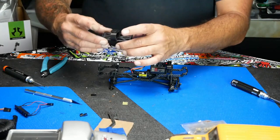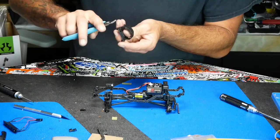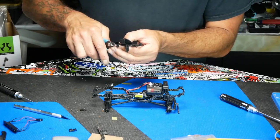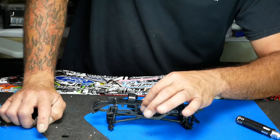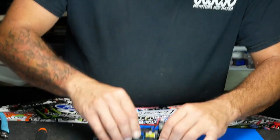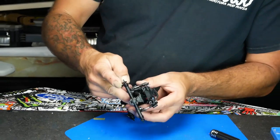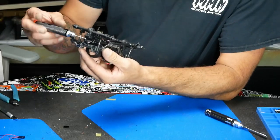Stock radio tray and battery tray in the back — same thing, we'll have to cut the nubs down and mount that in. We found interference with the nuts we made hitting the corners. Because the skid plate kicks up the back of the motor, now the back of the motor hits the battery tray. We'll trim a little bit of the battery tray. Remember guys, there are files on Thingiverse and Cults3D for free for 3D printable battery trays that go sideboard. We are going to get onto those, but that will come at a later date.